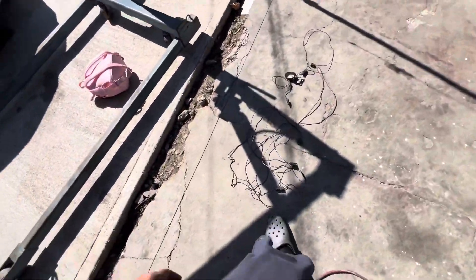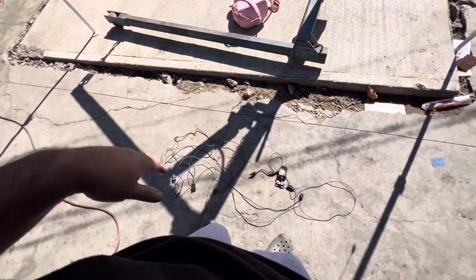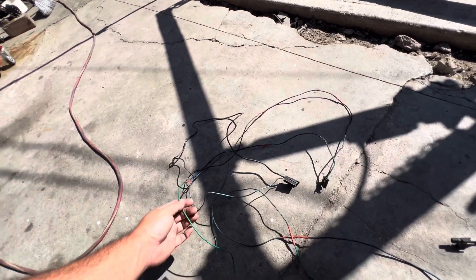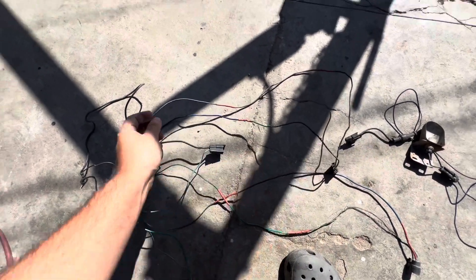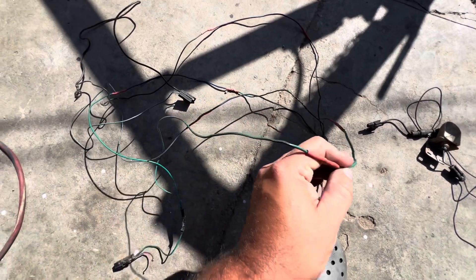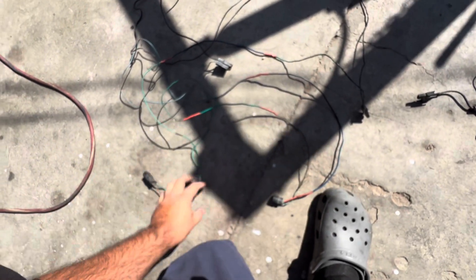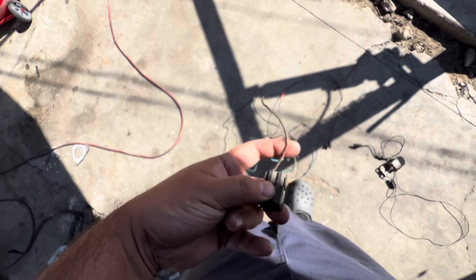There was a lot of damaged wire on the harness. That's the hood light — you can see they elongated these wires, mickey-moused this wire, and changed colors on these wires. That's why I opened them up — you can see it going from green to blue back to green, and it's damaged. Exposed damaged wire, all of it hidden under tape. That's why you take apart your stuff.